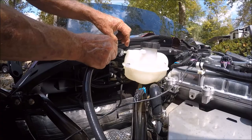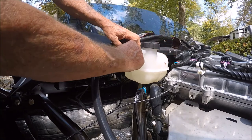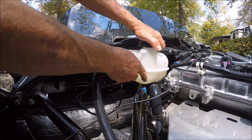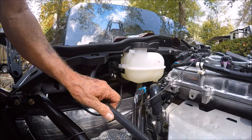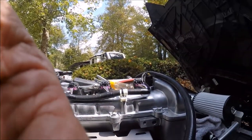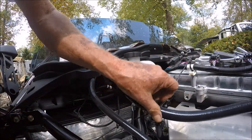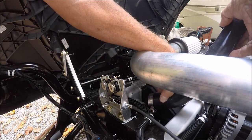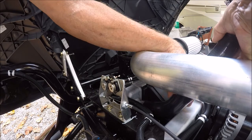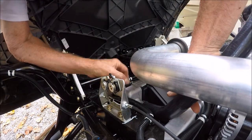Perfect — you can push this on and it'll be at the bottom where you can tighten it when it's up underneath there. We just push that on there, push it in, and then we can plug this back under. This is the hose that goes over to the top connection right over there. Let me dress these hoses up — this is supposed to be tie-wrapped along with this one up against there with the hose clamp like that.